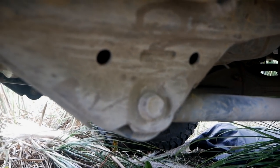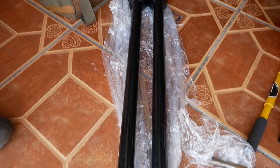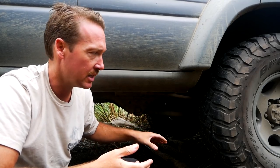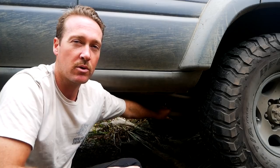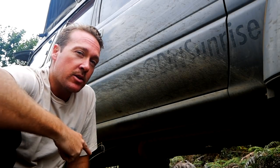Second thing: the lower link bushings. These were original OEM Toyota ones. I checked them out before the trip and they looked okay, but once we had done a bunch of off-roading they seemed to be cracking. So I went ahead and bought Wits End lower links — they're heavy-duty lower links, but the main reason I bought them was because they already had the OEM bushings pressed in. At home with a press it's really easy to push out the old bushings and push in new ones, but not knowing where I was going to be and what resources I'd have, I figured it wasn't a bad idea to just go ahead and upgrade.